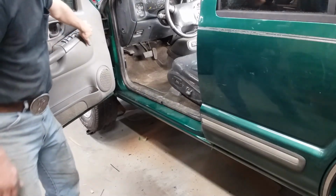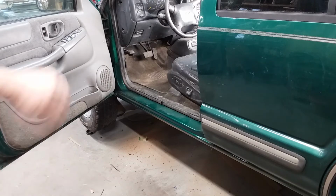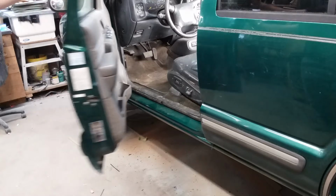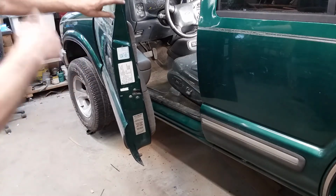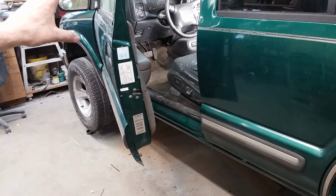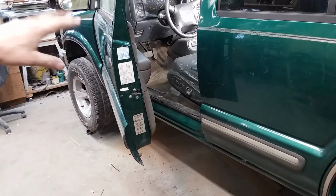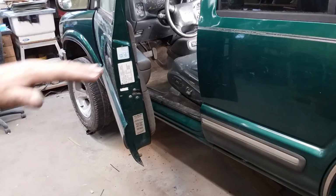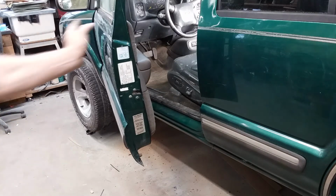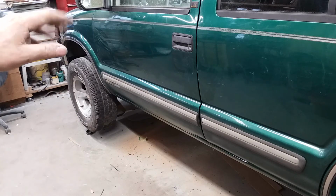and you go down in this hole behind this trim panel with your hammer while there's a lot of pressure, and I mean you're just about to pick the car up off the ground. You go behind there from the inside and take a little ball peen hammer and peen around where that hinge welds into the door, and it'll stress relieve it and allow that door to creep up just a little bit. After 2 or 3 tries of that, I got this door to where it shuts and aligns and everything is tight and right.